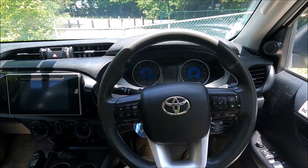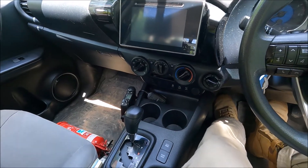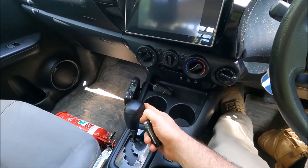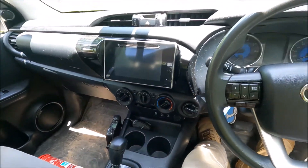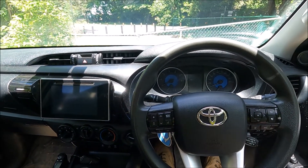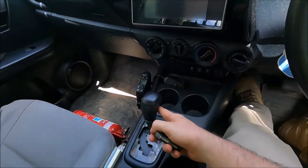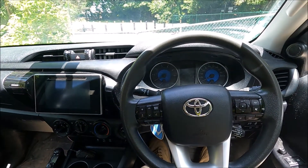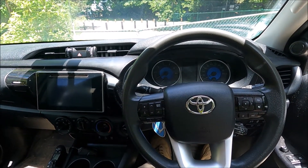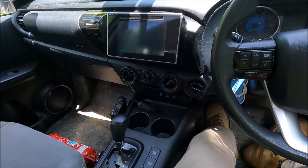The shift lock is a safety feature. If the car was running right now and my foot was not firmly on the brake, you would still not be able to move the gear shifter out of park. The reason for that is if there's no driver in the seat and passengers knock the shifter down to drive or reverse, the car would ultimately move — which is why the shift lock has been installed.